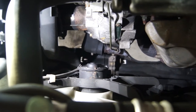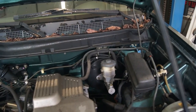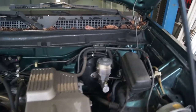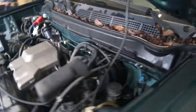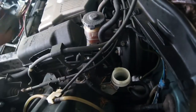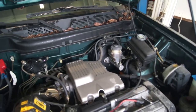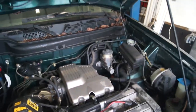You want to loosen that before you take both your bolts out, but once you loosen that you're going to start draining your brake fluid because the clutch cylinder — slave cylinder — is connected to the master cylinder. Well, restart that thought process — it's actually not. Usually they are, but this time it's not. I stand corrected. A lot of times on the newer cars, especially Subarus, they use the brake fluid for the clutch so it comes out of the same reservoir, but I just noticed it when I looked over there, so I stand corrected.